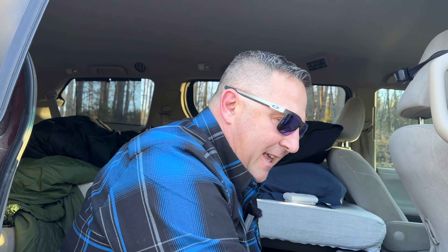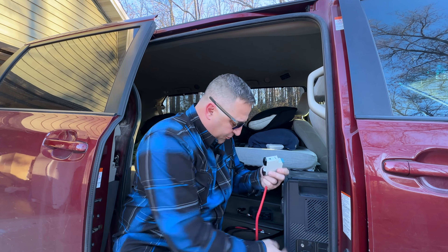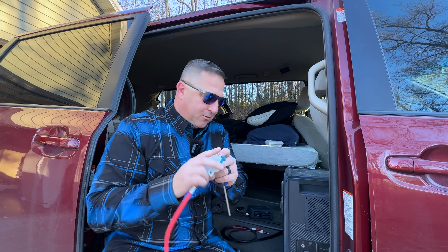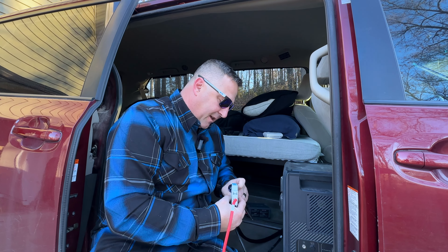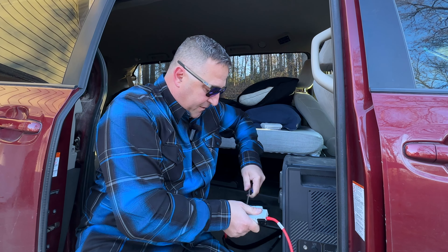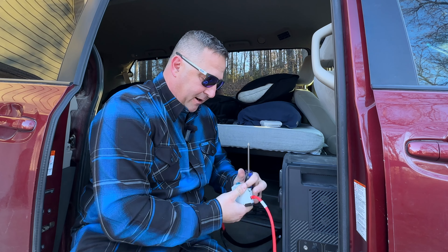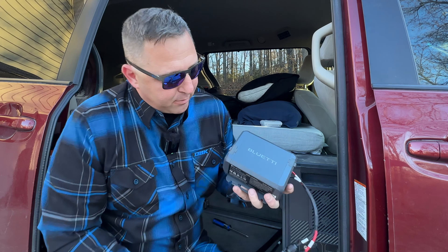What I want to do now is get the rest of the Charger 1 installed and hooked up. I'll start with the AC240 just to show you one charging condition, but then I'll hook it up to a couple of other power stations and show you how to change the settings so you can get it hooked up to whatever battery you want to charge. For the remainder of this process I really just need a 2.5mm allen key and a Phillips head screwdriver. The Phillips head I'm going to use to attach the positive output into the circuit breaker, which you can also use to turn the device off.